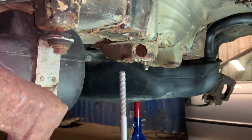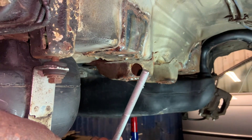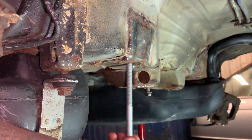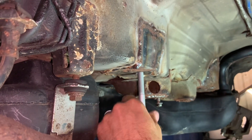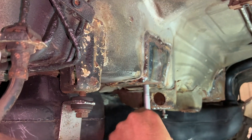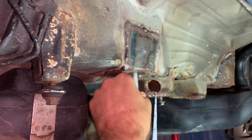We've run the threading tap and cleared the debris and epoxy out of all four subframe mounts, and now I'm about to install one of the front studs. As you can see, this is obviously not finished — there's going to be additional work done here — but just to show the principle. Now that the thread is cleared and nice, this is easy — just screw it in with your fingers. I have a measuring tape and what we want to do is run this to just about 90-something millimeters.